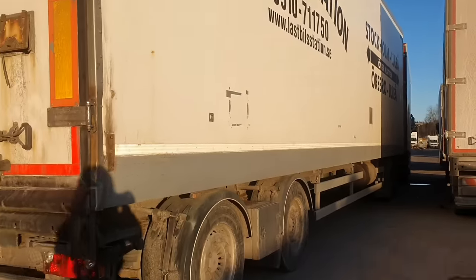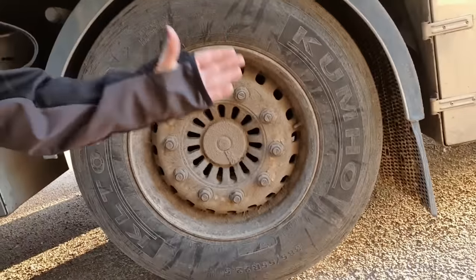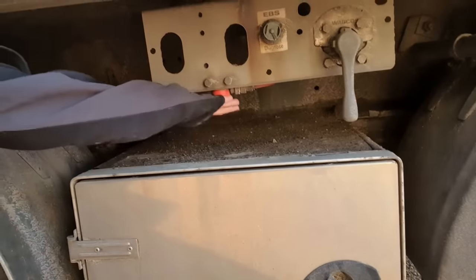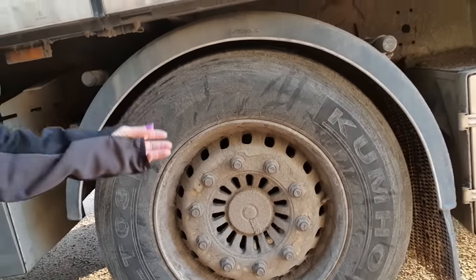If you ever get a locked disc brake - it has happened to me several times - it is when it is warmer during the day and gets colder at night. Mostly during the night when we are loading and unloading our wagons, we always attach the catastrophe brake. When you attach the catastrophe brake, it is a spring that gets attached on the disc brake on the wheel, so the wheel gets locked. When we are unloading it takes some time, it gets cold, it gets freezing. When you are about to roll, you put the catastrophe brake off so the spring should go to its right position. But when it gets cold and freezing, the spring in the disc brake can stay attached in its locked mode because it has frozen like that.